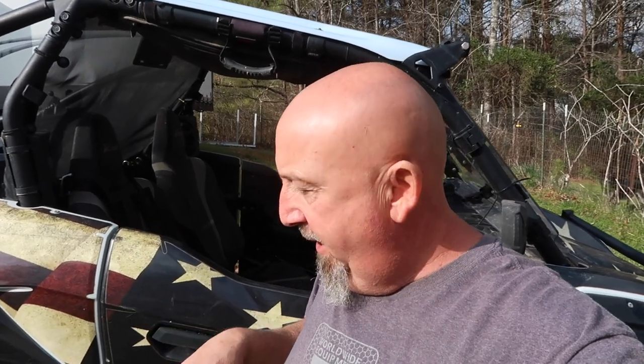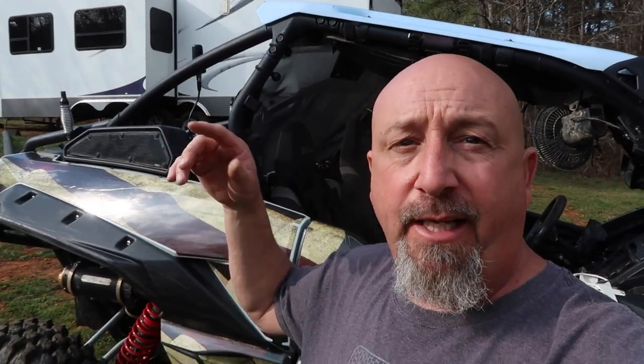I've got the springs installed. It was supposed to have a 16.5-inch clearance in the front and 16 in the rear. Actually I kind of got it flipped — I got 17 in the rear and 16 in the front. But I'm going to make a ride or two on them first and let them settle before I do my final adjustments. I also just barely got enough room for it to clear the front going into the garage. Guys, give All Things UTV a shot — I was really impressed with how fast they sent the springs out. Support your local business, that's what I like to do. Thanks for watching, please subscribe.